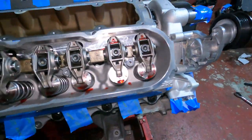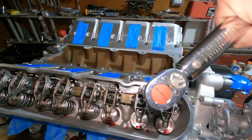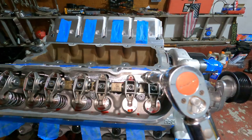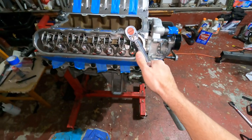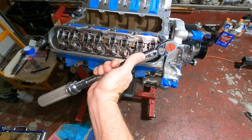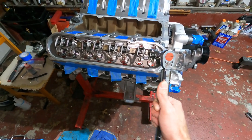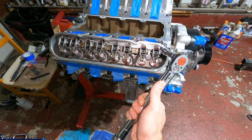So when I get to that point, I would start the torque wrench here at the 12 o'clock position, and I would turn it. Now, my target was between like here and like here, which is like 45, 25. So I was getting between here and a little more, so that's perfect. So these things should be good to go, but I will demonstrate it on the other side of the engine. Like I said, I just wanted to do a trial run on this side.